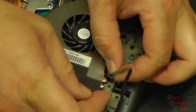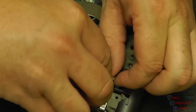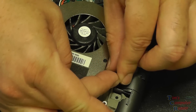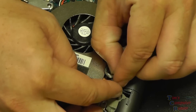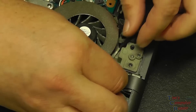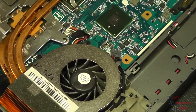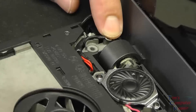Feed the wire back on the bottom side and get everything plugged back in. You may have to work with the ferrite a bit to get it to go in correctly — reposition it if needed. As long as it's there you don't have anything to worry about. Take your time, get everything put back into place, plug it in, and make sure all connections are good.